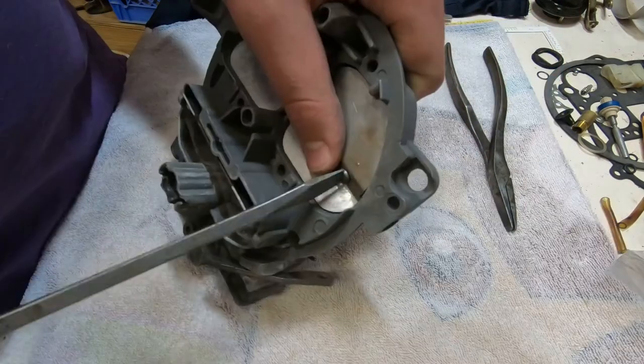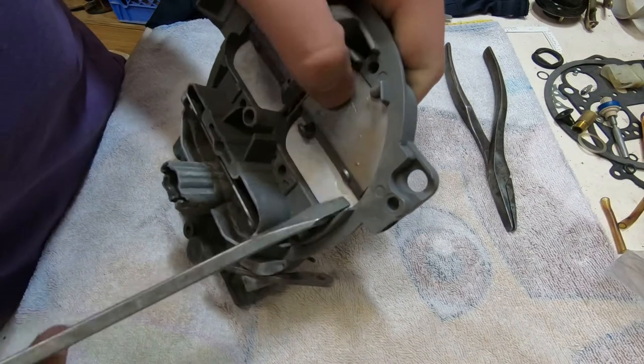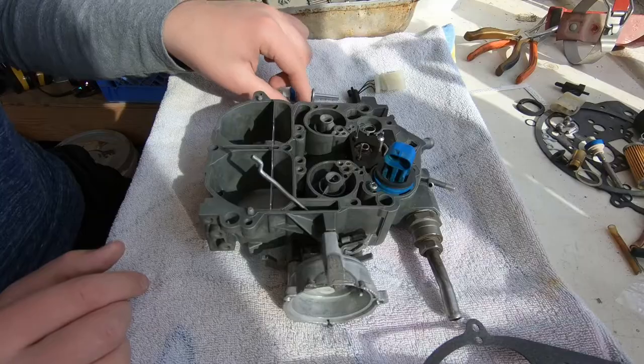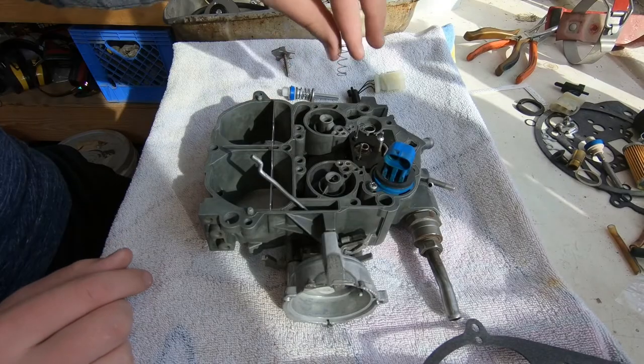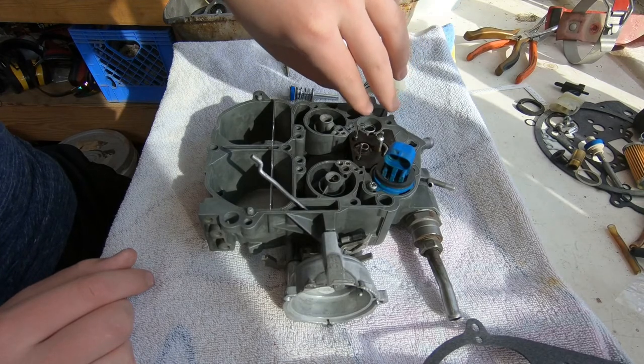We are using different screwdrivers at different points because, as I was explaining to Dylan, you basically want to use the fattest straight slot screwdriver that you can in each straight slot screw. It minimizes the chance of tearing up the screw.